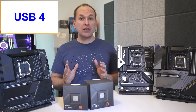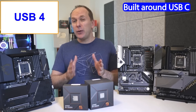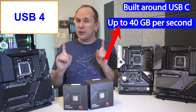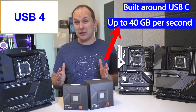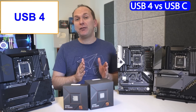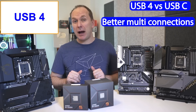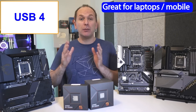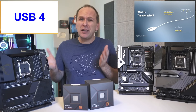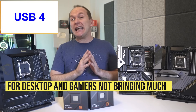One feature that some users might be interested in is USB 4, which we could do a whole video on. In a nutshell, USB 4 is built around USB-C and offers data speeds of up to 40 gigabits per second — note, not all USB 4 devices will run that fast. They also allow power delivery. The advancement over USB-C is that USB 4 will support multiple devices over the same connection much better, including that power delivery. While USB 4 will be great for laptops and mobile devices, it isn't really clear if it will offer much to enthusiast desktop PC users, possibly as an alternative to Thunderbolt 4 for those in the Thunderbolt data ecosystem.